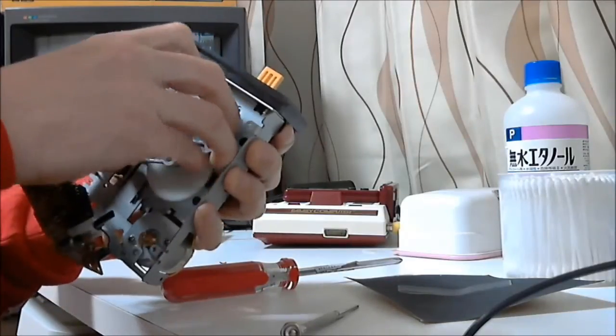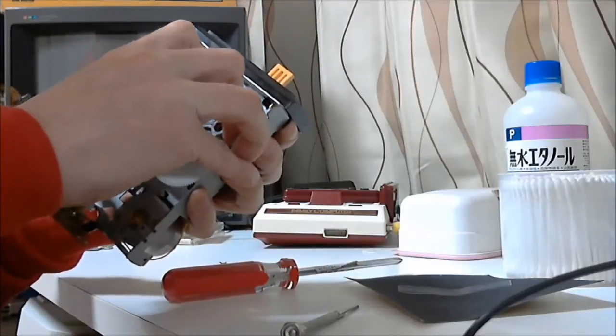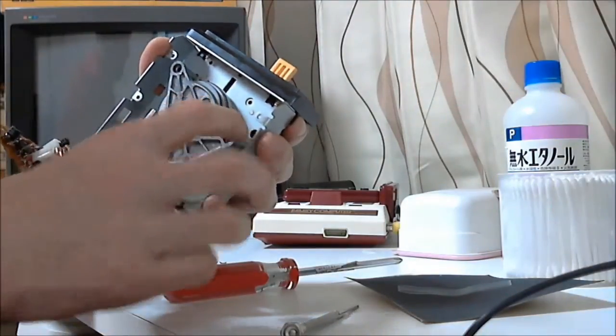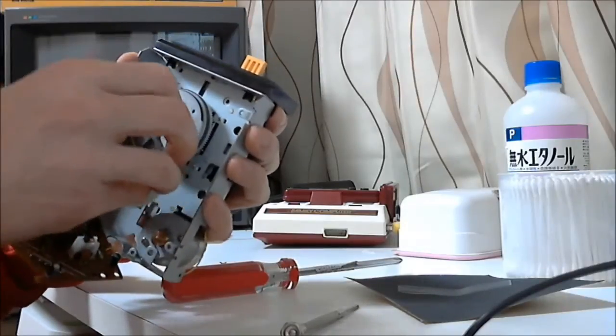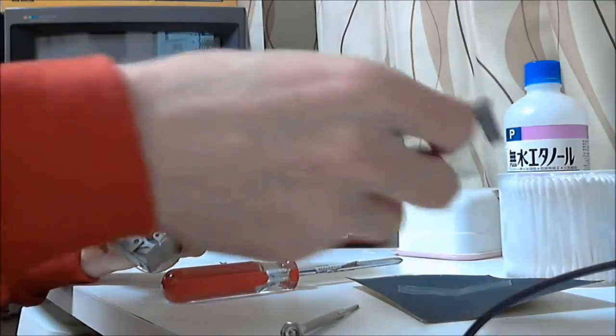That sound you just heard is the drive mechanism sliding back. Now the cog is not holding it in. That's okay, it's supposed to happen. Now you've rotated it about 10 degrees. Pull a little more and slide the plate down and to the left while turning it further clockwise. Keep sliding and it'll finally come free.